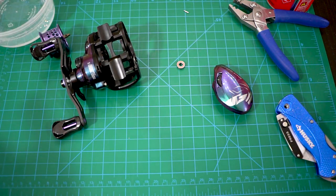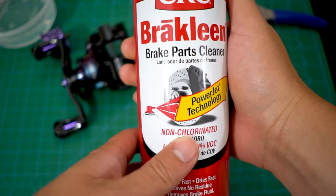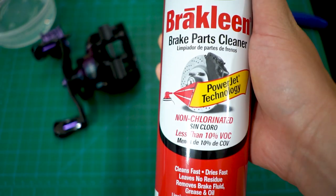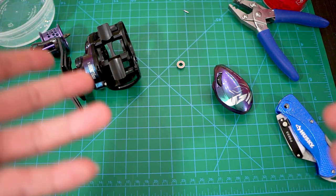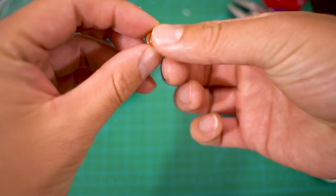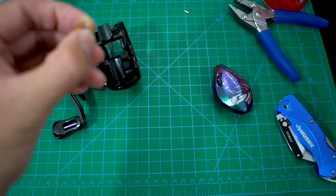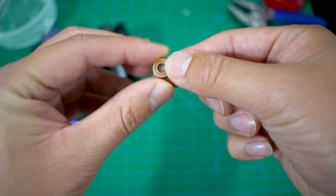You can use all sorts of chemicals to clean your bearings. For instance, I use this CRC brake clean — there are a couple different versions, this is the flammable one, not the ozone friendly one. Other things I use are acetone, nail polish remover — heck, people even use gasoline — because all these chemicals are degreasers. Depending on what type of chemicals you use, you definitely want to clean the orange seal separately, because it's some sort of stainless steel ring with a plastic coating over it.